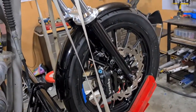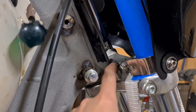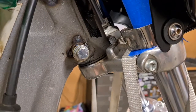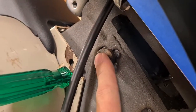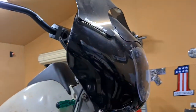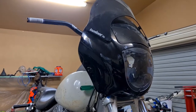You can probably see already it's going to be kind of black with a machined aluminium look to it. 39mm, just regular 39mm triples — I don't even know what they're off, narrow glide probably, sporty. I've welded on a new stop tab just to suit the triples. The previous owner had ground these off, so I've made new FXRT fairing bungs to fit on there. Currently I've got a thin knock-off quarter fairing — I don't think it's any particular brand, probably just eBay — but it's pretty nice with a Laminar Lip.